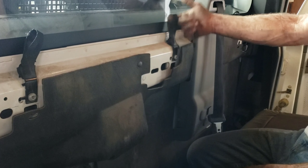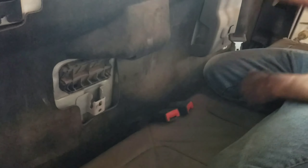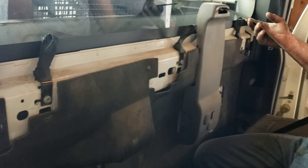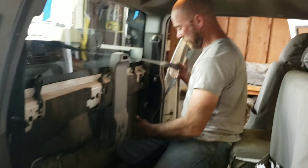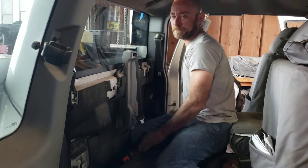The center tab is lined up with this strap for the child seat. When you go to put the seat back in, there's a hook here and a hook here, and there are just little bars on the back seat that are going to slide in. Make sure you slide it underneath this seat belt — I've made that mistake before. So slide it underneath your center seat belt, put the bottom rails in, and clip it in. That's it.